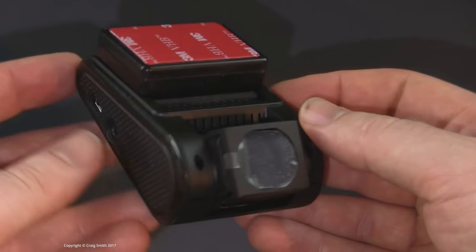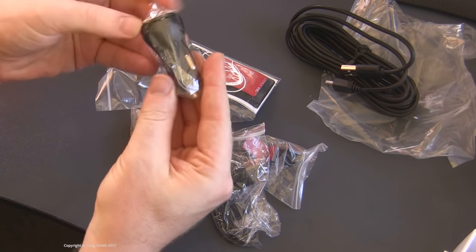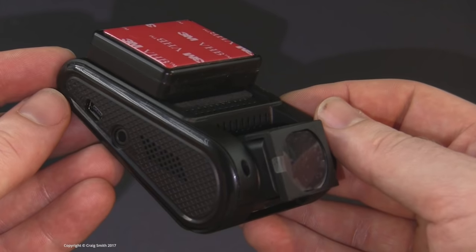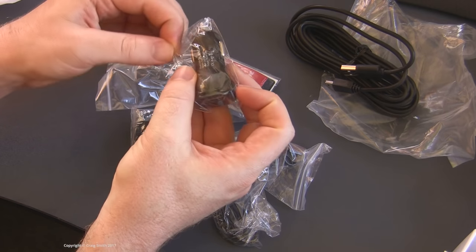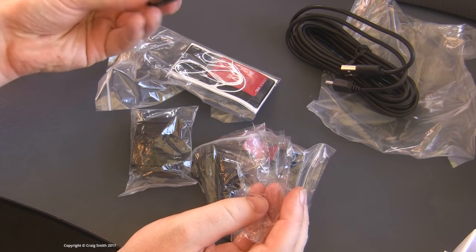This particular camera is USB powered and comes with a cigarette lighter style adapter. There are pros and cons to these USB powered devices. The pro is that they're very simple and use standard USB type hardware, but it means that there has to be this separate external power supply to drop and regulate the car's 12 volts down to 5.